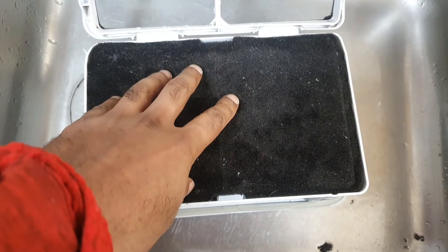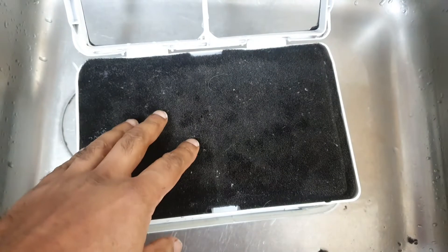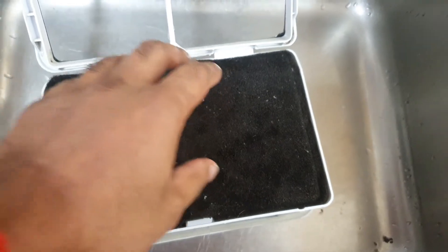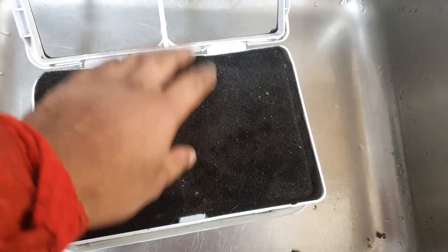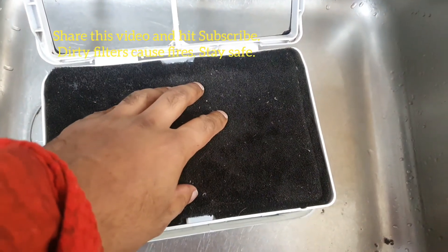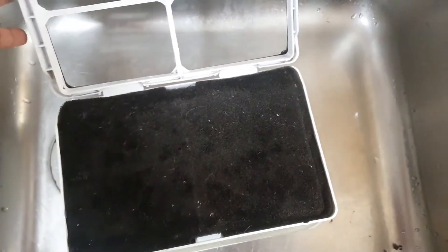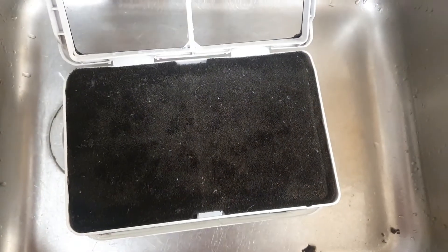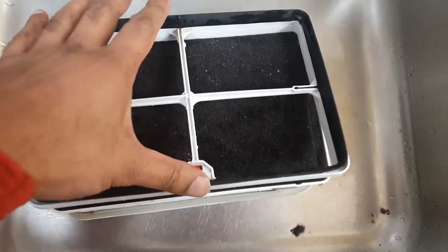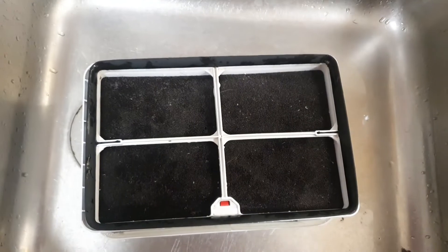Try and keep the cleaner side to the outside — that's the part going towards the filter — so that the dirty air is sucked in from the dirtier side and goes towards that filter. This foam, by the way, is a special type that doesn't filter everything — it allows moisture to pass through. Make sure the edges are not damaged and there are no gaps that air can bypass through. Just press it down and fit it, and that's your filter done.